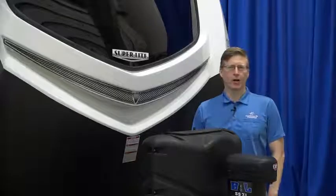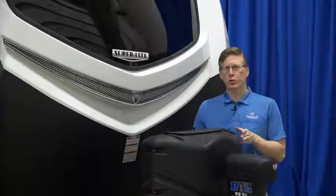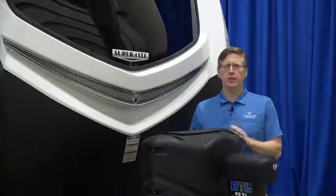We'll begin here at the front of your RV. Underneath this cover, you'll find your propane tanks. There are two of them connected by an auto changeover regulator, so if one runs dry, the other one will kick in. Behind that, you'll find your battery hookups. When your RV is in storage and not connected to an electrical outlet, you'll want to disconnect your battery.